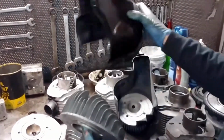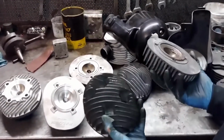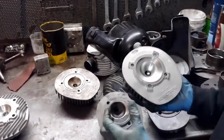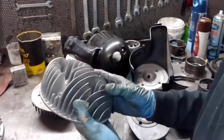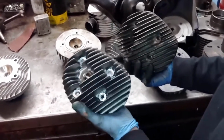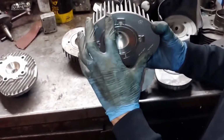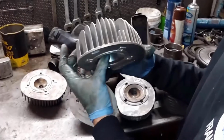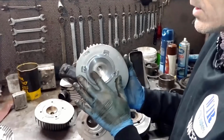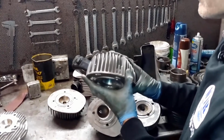Now, I'll show you some differences between the heads. We said this is the Piaggio one, this is from the Rally, and this is not, but in short, the head is the same. And then there are the elaboration heads. This is Malossi. It's a good head, certainly better than the Piaggio because it's also slightly heavier. Then there is also a little more aluminium, which is good, because the fact that the thickness of the wall is greater prevents hot spots, which are terrible, since they bring self-ignition.